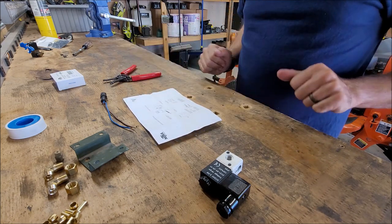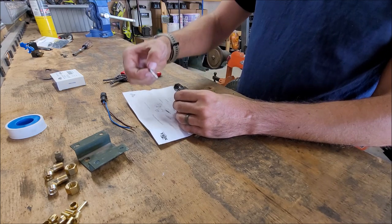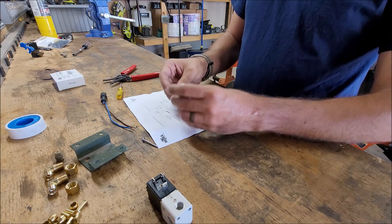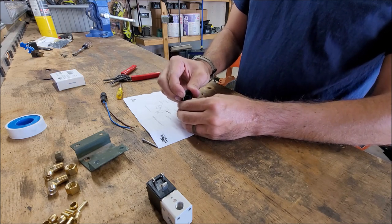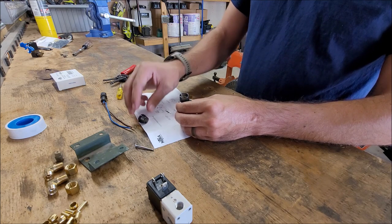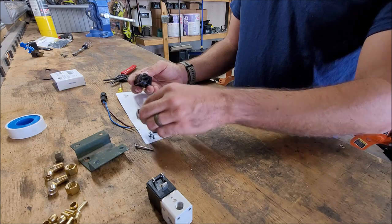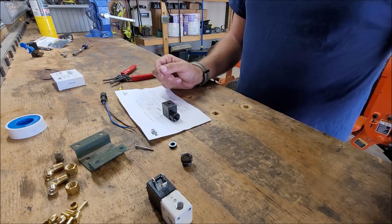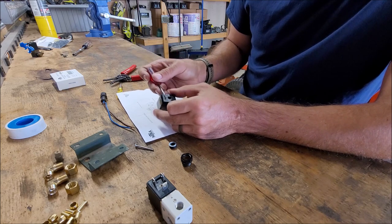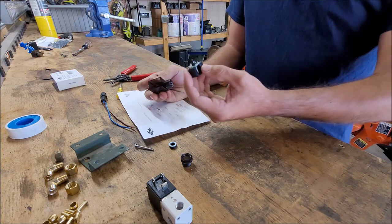I'm going to flip over the electrical. Use the Phillips. Screw all the way loose. It pulls off. Put that to the side for now. Then this should only be like hand tight. Get that off and turn it upside down. Tap it, you should get a little metal washer and a little rubber washer that come out as well. Then use your little flat and use this. It should get your little connection piece out. And that's where you're gonna make your connections.